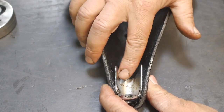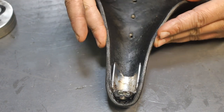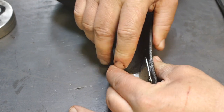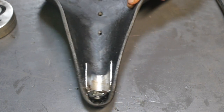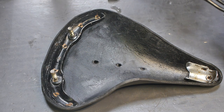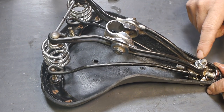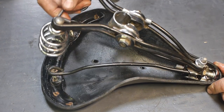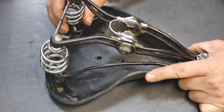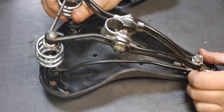After a long session with the hair dryer, the grease has melted sufficiently behind this metal piece, and this leather saddle has flared out a bit. I might need to put a wrap around this front section of the saddle. First I will put the saddle back together and go for a test drive. I'm going to back off the tensioning pin and loosen up that new bolt I installed — that way there will be some play at the rear so I can force the springs back into position. I think this will be a frustrating job.